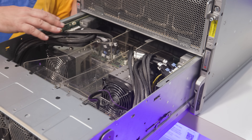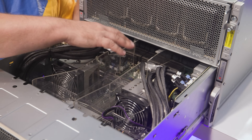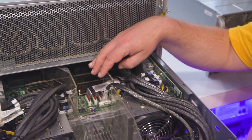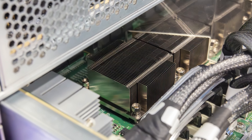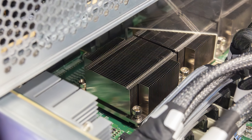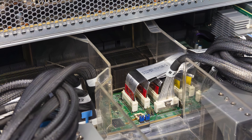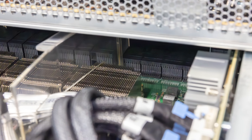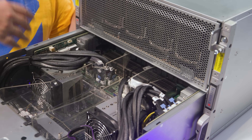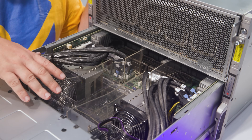There's also a pretty elaborate PCIe switch scheme. This is the main PCIe switchboard with four switches. On each of the four switches, there are two GPUs, two NICs — one for each GPU — and two NVMe SSDs, with links back to the CPU. Replicated four times, that gives us eight GPUs, eight NICs, eight SSDs, and links back to the CPUs.